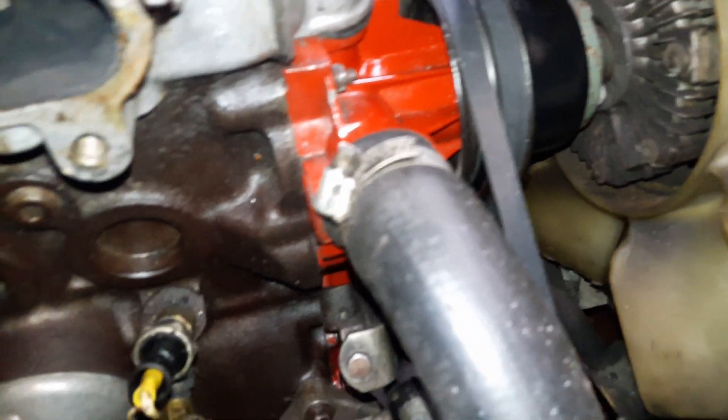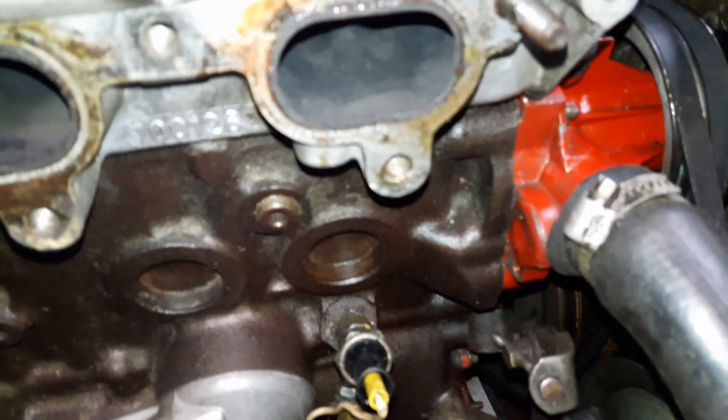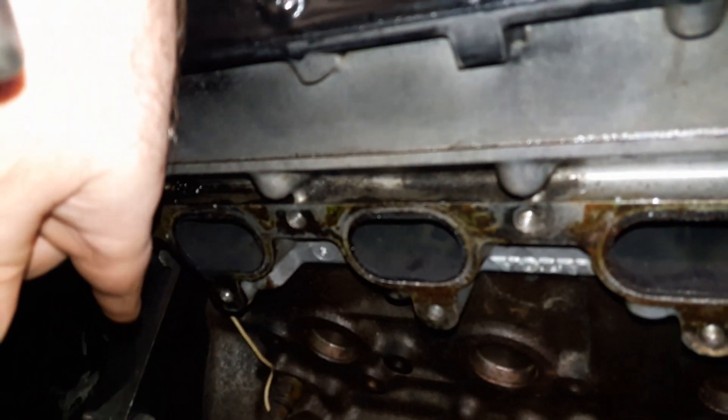But if we take a closer look, well, maybe it is a little bit different. What's it missing here? You know what it's missing. It's missing that stupid tube that goes from here all the way back through here and goes to the heater core. And then the other side of the heater core comes over here and plugs into that line that I have blocked off there.